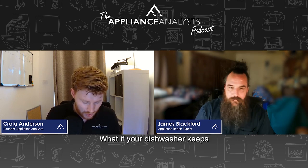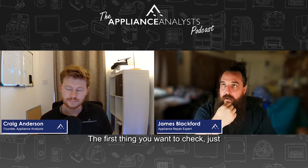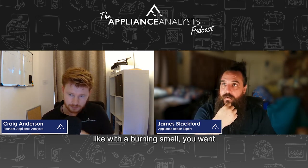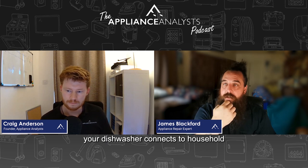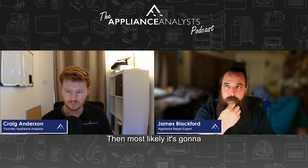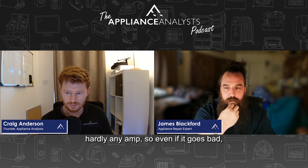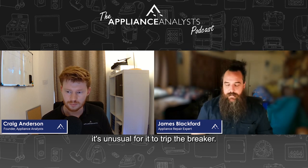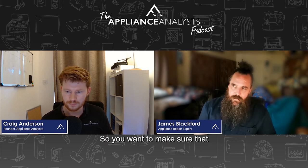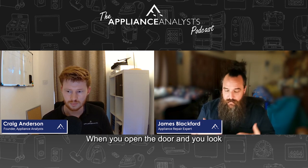What if your dishwasher keeps tripping your breaker? The first thing you want to check, just like with a burning smell, is that the wires where your dishwasher connects to household power are nice and clean, nothing looks burnt. If that checks okay, then most likely it's going to happen when the heating element's activated. The wash motor really doesn't pull hardly any amps, so even if it goes bad, it's unusual for it to trip the breaker. So you want to make sure your heating element looks okay, just visually inspecting it when you open the door and look inside.